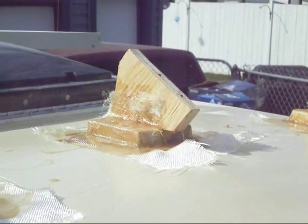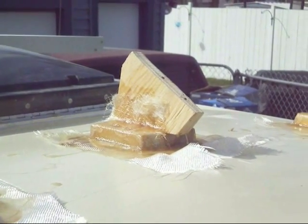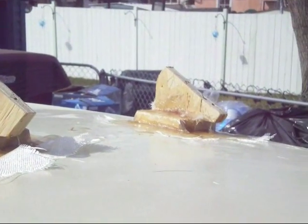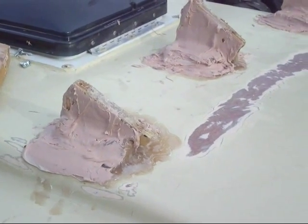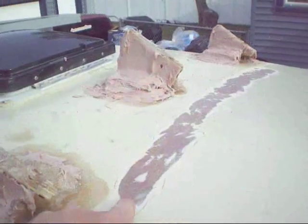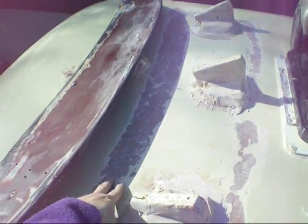The excess I'll trim and I'll put a couple more layers on here to make sure it's good and strong. I've applied a layer of Bondo and it's dried so now I'm going to have to take a file on that and roughly shape it. At the front here I've ground it down to fiberglass — I've roughly got everything ground down, I've ground off the gel coat right down to fiberglass. So when I put the air deflector on I'll be able to fiberglass this and I have some fiberglass to attach it to.